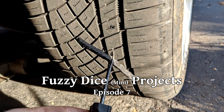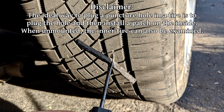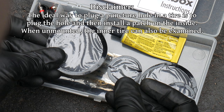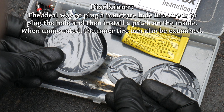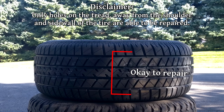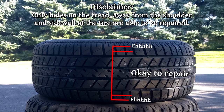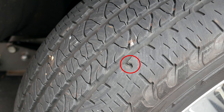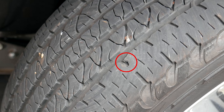This is going to need a couple big disclaimers. First off, this isn't the most proper way to plug a tire — that involves plugging the hole and installing a patch on the inside of the tire after unmounting it. The second disclaimer is that this is only going to apply to a hole near the center of the tread. A hole in the sidewall, or even getting close to it, should not be patched or plugged.